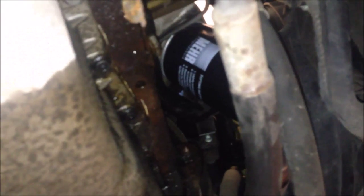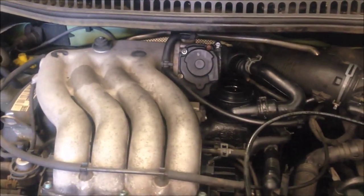Hand tight — tighten the new oil filter on. You can see there's a bit of oil that came out from when you took it out. I took out the plug again just to let it do a final drain. It's quite surprising how the release of that produces a lot more coming through, so it's certainly worthwhile to get all the last dregs from it. Whilst you're under here before you put your plug on, just take a paper rag or paper towel and give all this a bit of a clean up.